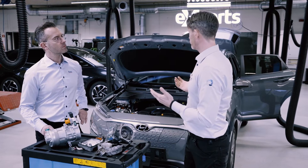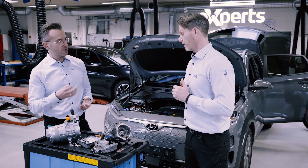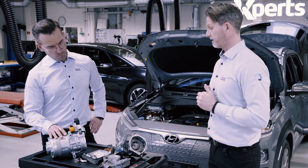Another advantage is that you can place the compressor anywhere in the vehicle — it's not related to any kind of drivetrain. That's a big relief for engineers, as it doesn't need to be in conjunction with the drivetrain. There are also fewer mechanical elements, which means less noise generation — especially important in electric vehicles where there's no combustion engine masking sounds, and no clutch engaging and disengaging. These are significant advantages for electric and hybrid vehicles.